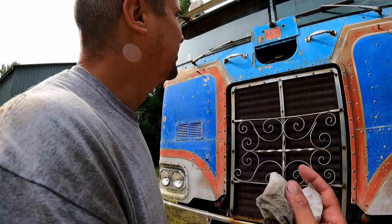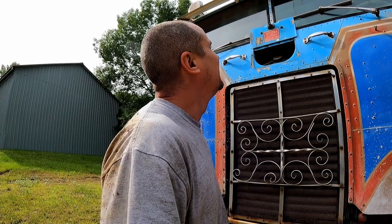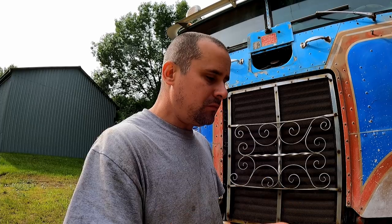I'm gonna tilt the cab first and then we will fire it up and let it run for a little while. It's not really a cold start because it's summertime, but it's probably in the 60s here. So, it'll be the first kind of semi-cold start in 40-some years. But I'm real curious to see how it starts after sitting overnight, because we don't have that return line put down to the bottom of the tank. Remember, the tube was busted off, and I still haven't gotten one of those yet. So I'm real curious to see if it lost its prime overnight. We'll discover that together. Hang tight.